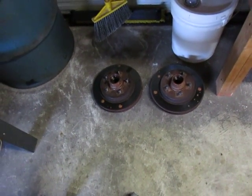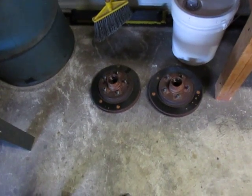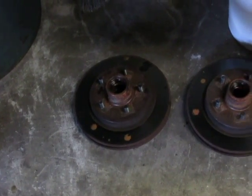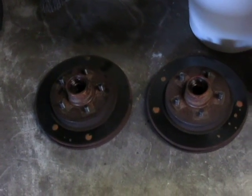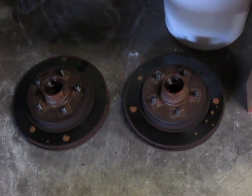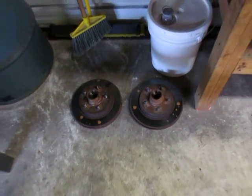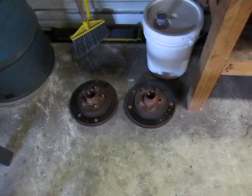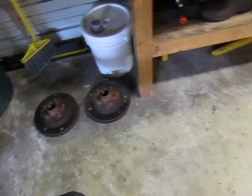To me it's just garbage rotors. These were actually the best that Napa had, and now they're screwed up. I could have them turned and put some new pads on, but my experience has been you have them turned and five to ten thousand miles down the road you're right back at square one again.